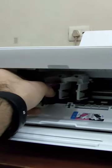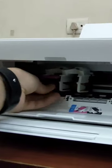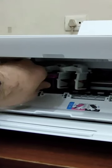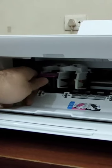From the stickers you can see the left one is tricolor and the right is black. The tricolor goes in the left slot. I was struggling a little bit the first time installing this. In the back there is a chip that connects to the printer. The method I used was to place it inside and push from down to upward — it will give a tick sound, and from that you can consider it successfully installed.